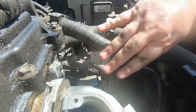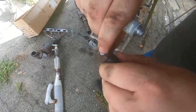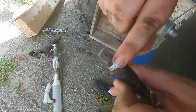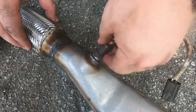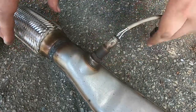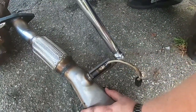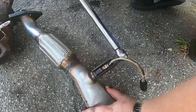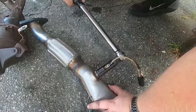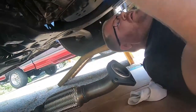All done. Now we're working on the downstream O2 sensor — same deal as before. Put your anti-seize lubricant around the threads all the way and start screwing it in. At this point Bob was there helping me — he was busy on day one but came the second day to help install, so he's the one holding the camera.